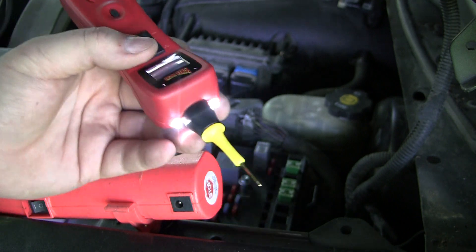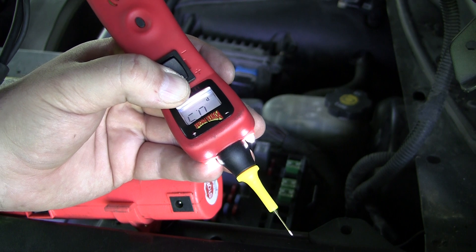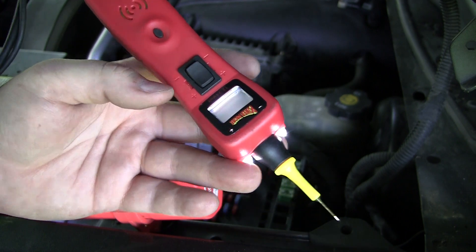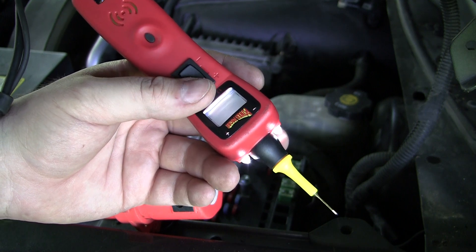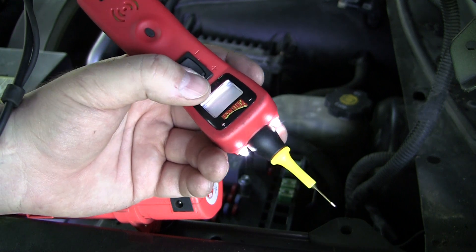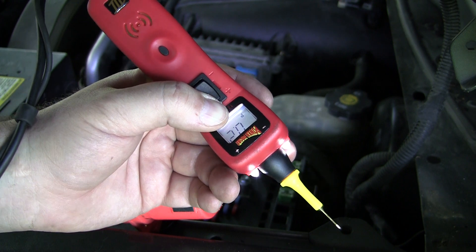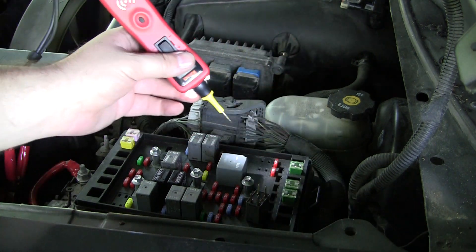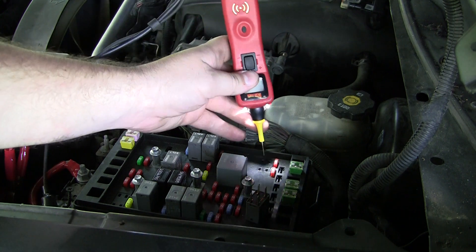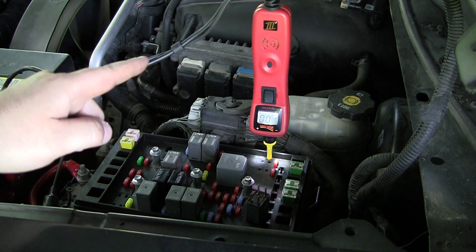I've also noticed last night when I was driving that the headlights kind of flickered, and the instrument cluster flickers as well — so maybe I do have some kind of electrical issue going on here. Really weird. Well, all that led me to believe we are getting a signal to the relay, so now I want to check between that point and the wiring at the compressor.